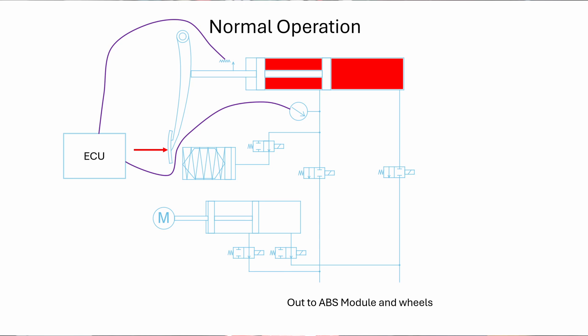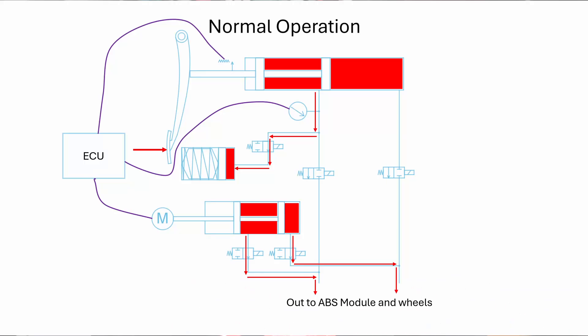The pedal resistance builds in the same way as a normal brake system, so the driver thinks they are pressing on a brake like the ones they have become used to in all the other cars they've ever driven. Manufacturers can tune the spring in any way they want to give the pedal feel they want, from soft to stiff and anything in between. As the driver pushes down on the brake pedal, position and pressure sensors measure what they are doing and send signals to an ECU. At the same time, hydraulic pressure from the master cylinder flows to the pedal feel simulator, where the fluid moves a piston that compresses the spring and rubber donut. The ECU then takes the signals from the pressure and position sensors and translates them into electrical signals sent to a small electric motor built into the unit. This motor drives a piston in a second master cylinder hidden inside the module, and pressure from this second master cylinder is what is then sent out to the wheels via the ABS module.